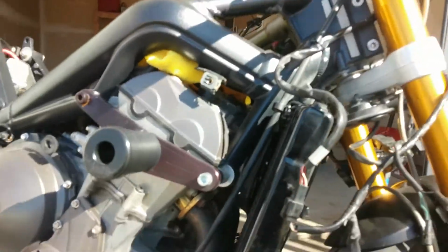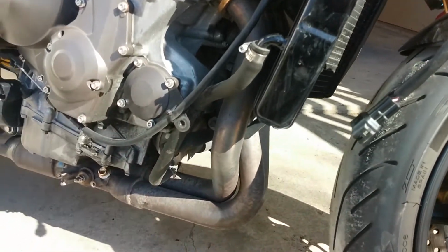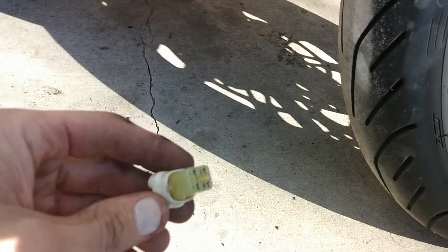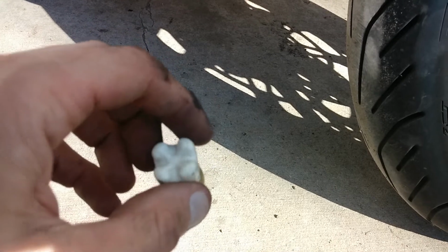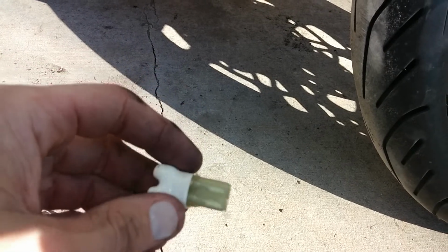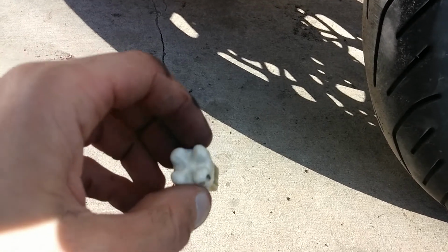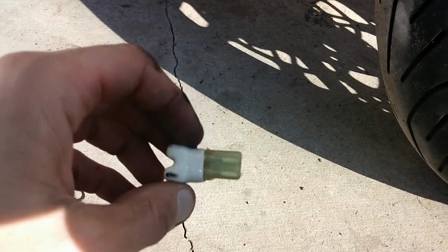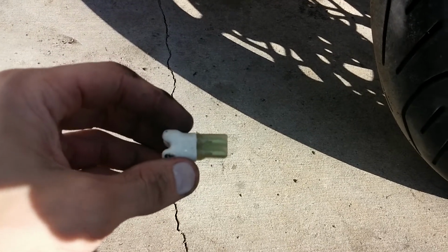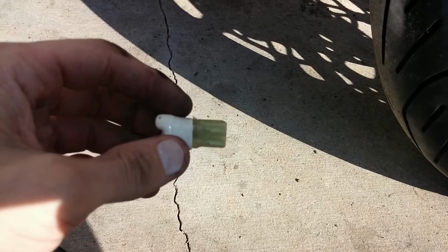Now, if for any reason you wanted to simply disable it without actually making an adjustment on the computer itself, which I have already done, you can buy one of these. Now, this is a little Lambda O2 sensor eliminator. The way it works, to my understanding, is there is a resistor inside here that equals the signal provided by the O2 sensor when in optimal air and fuel mixture load. So for the times that it's not on startup, and also the times that it is simply in that range where the EPA measures the emissions, then this is the signal that it will replicate.